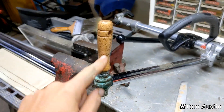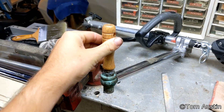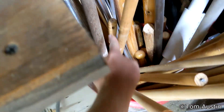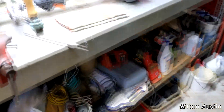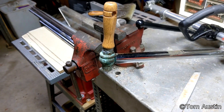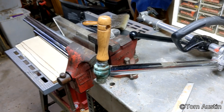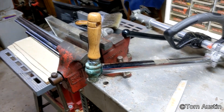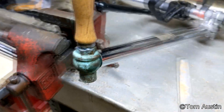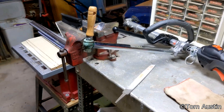Once I did that, this has a square post with a female thread on the top of it. I went back to the screw bin and found a nice 2-inch long screw that fit the threads inside of this spigot, ran that down in there, cut the head off at an angle. This is a rolling pin handle — I just have an excess of these over in the dowel bucket because I bought four rolling pins trying to make cotton gins. I bored out a 5/32 inch hole through it for the spigot, then at the end of that bored a 1/8 inch hole for the screw, got it in by hand, and then beat down on it with a hammer until it seated.